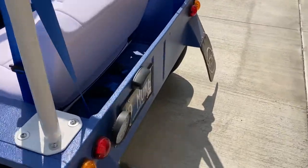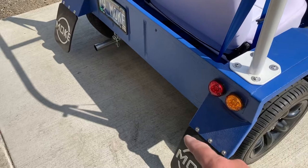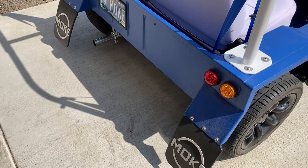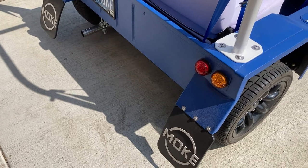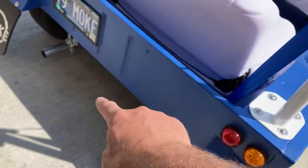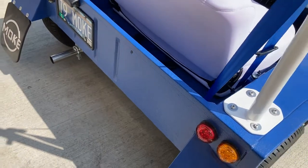The back one — I've still got the frame from the original, and it's got a kind of a hoop, but it's an offset hoop which looks really silly. So I think I'm just going to use the original frame and have a big piece of tube welded across there. One thing they talked to me about at the welding shop was that since the spare is going to sit there, they could dish out the tube so it kind of supports it a little bit.